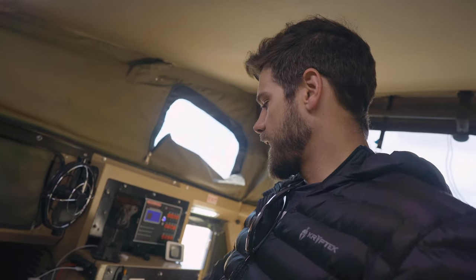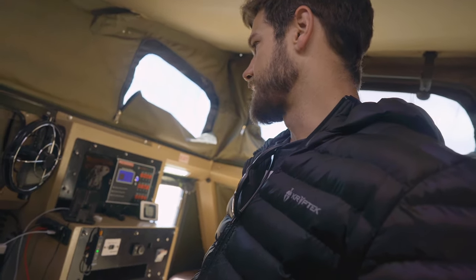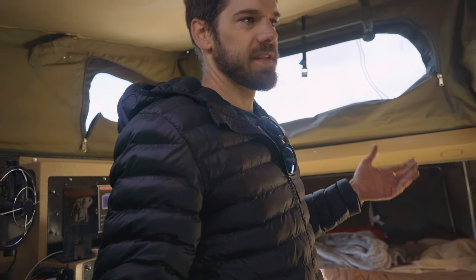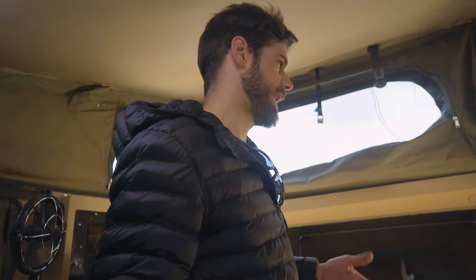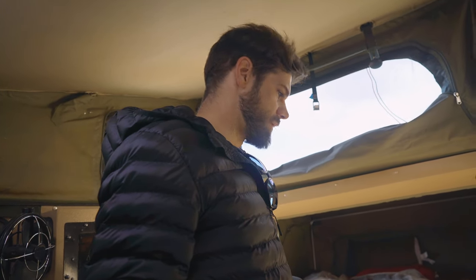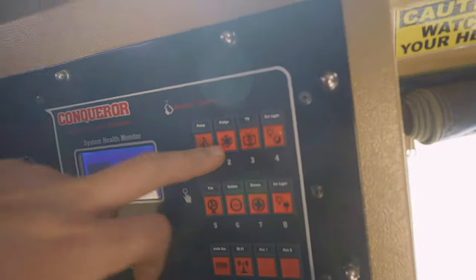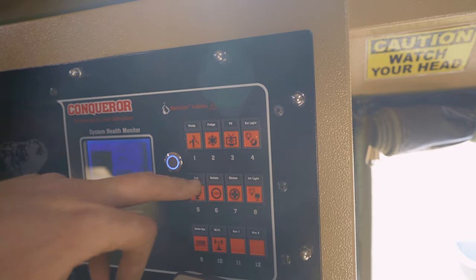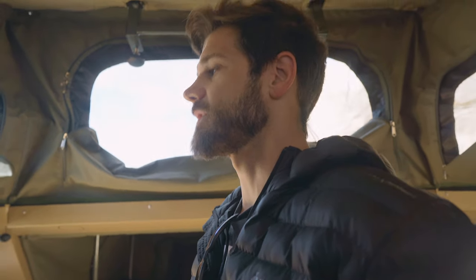One duct is taking care of everything — there's not really room to run much more ducting. The original heater these came with in Africa and the US models was a glycol liquid system that heated a radiator and blew through it, but I didn't want to deal with that. Diesel heaters are easy, I know how to work on them, and any semi truck place has someone who can work on those things. So I chose diesel heat. It's pretty nice — you've got fridge, water pump, TV hookup, and fans, and you can turn off any one thing individually.